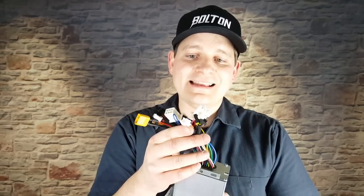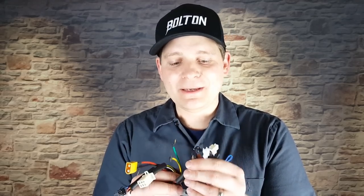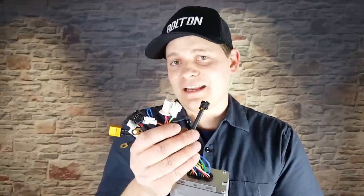The next thing I want to talk about is the motor controller and the connections that go from your screen, your throttle — basically any of the weak points on the bike where moisture could get in. And if you've installed an aftermarket e-bike kit, you are likely to find a bunch of connectors like this, and these are not waterproof nor water resistant by any means whatsoever.